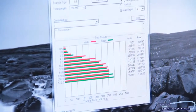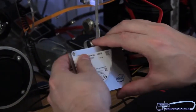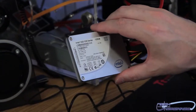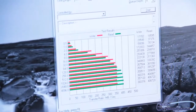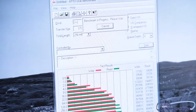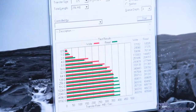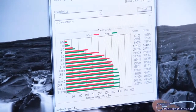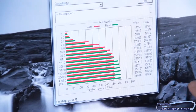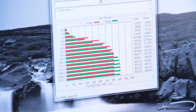I've got the drive right here in my hand while it runs the whole time — no heat, there's actually no heat. SSD, no noise. Just to let you folks know, different controllers show different results. I'm using the AS Media chipset that's on the motherboard today. You guys can see on our scores I got a little bit over 400 on read and a little bit over 360 on write using this particular chipset.